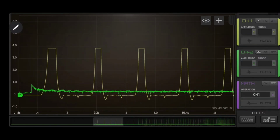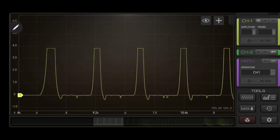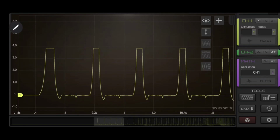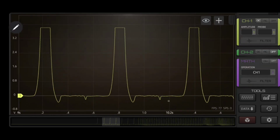Now, do you see how we can see the little bit of an exhaust push, but you see how we have no intake mark here? We see where it opened a little bit, but we have no actual intake mark there. You have actually no intake valley there. Now, the difference is, this is the same car.